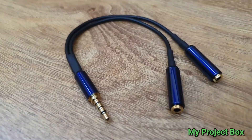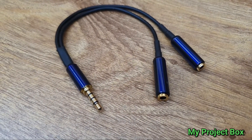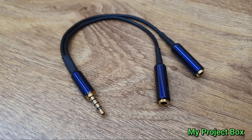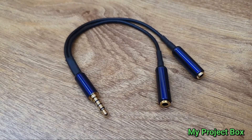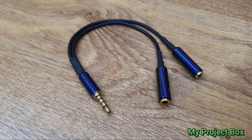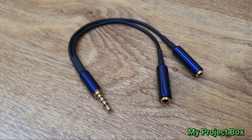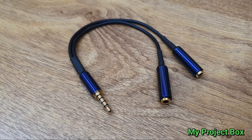So there you have it — the finished product. I think it came out rather nice. I have since realized there is another way without making this adapter: you can connect Bluetooth headphones. It's a bit tricky and doesn't always work — what you have to do is plug the microphone in first in KineMaster, then attach a set of Bluetooth headphones or Bluetooth speakers afterwards, and the sound will come out through the Bluetooth. You can still use the mic at the same time. It's a bit hit and miss, but it is another option. This hardwired option is a lot more robust.